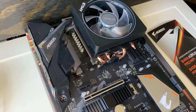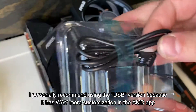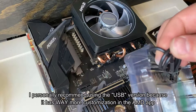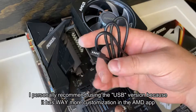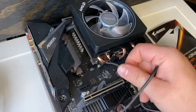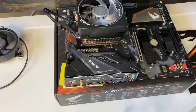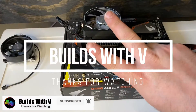Since this is the Ryzen 7 CPU cooler, it comes with two separate cables. The one that says USB gets plugged into a USB header on your motherboard, and the other end plugs into the cooler itself. The second cable plugs into the LED CPU header right here on the board. And that's overall how you install a CPU and a CPU cooler. Hope you enjoyed this video — give it a thumbs up and I'll see you in the next one, peace.